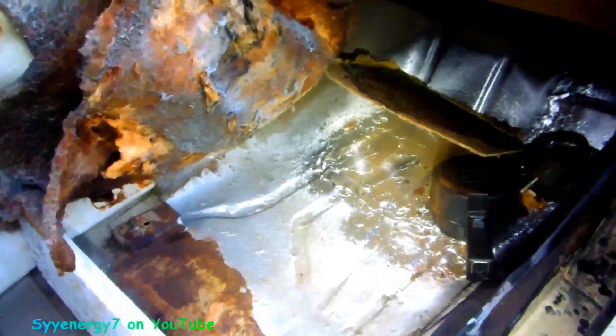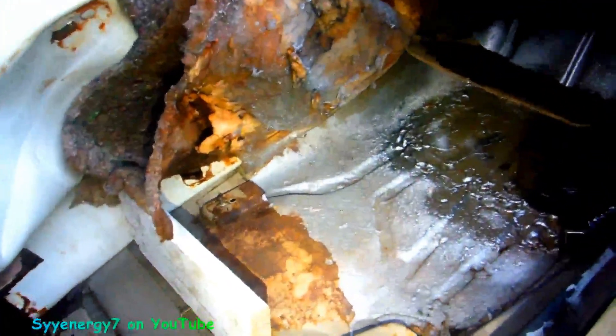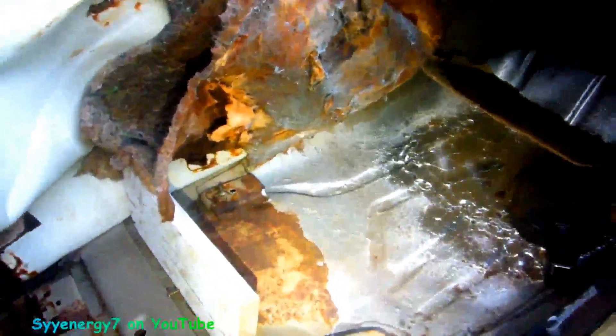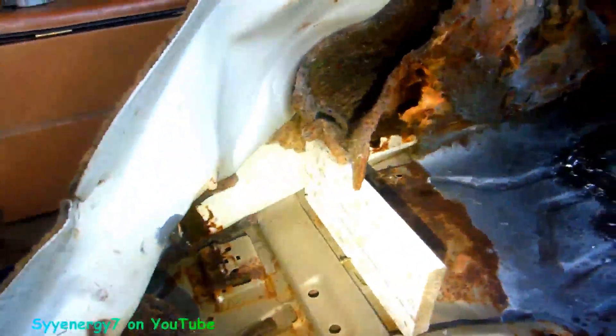I was just a little bit messed up over here — that's got a new steel plate in there, so it's been epoxied, chassis savor'd, and undercoated. I didn't weld it in; actually I riveted it in with epoxy, chassis saver, and rivets. I ground down where I put the epoxy so it's more rust-proof.